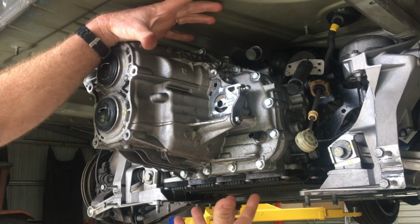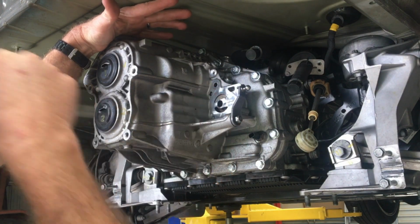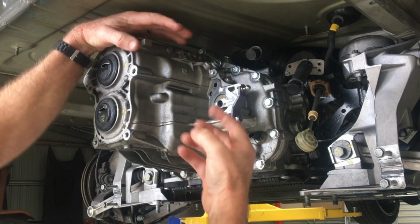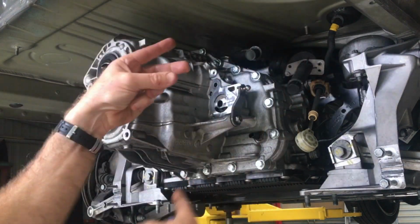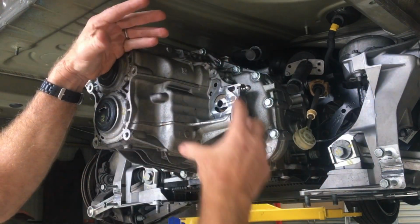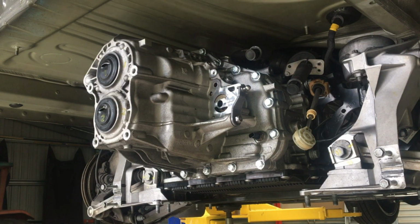That's fine, you can put a bucket underneath it, but the problem is that because the oil and the coolant side will now kind of get joined on the inside, if you like, between the gasket, you can get some oil down here. Now we're going to pull the cover off anyhow, but to save that happening, what you can do is, they are 19mm inside diameter hoses. If you just get a couple of bits of that, you'll have the two connections there. Put 2 bits of pipe, put that down into a bucket and just blow some compressed air through it, and that'll blow all of that coolant out of the cooler, so when you pull it off you don't have the problem of possibly getting some coolant inside the gear chamber.